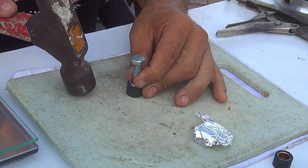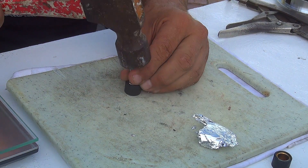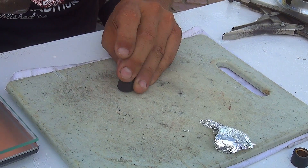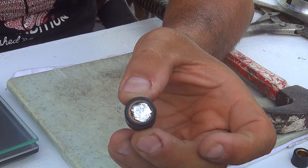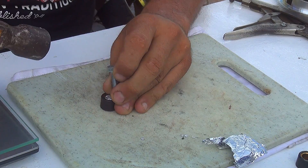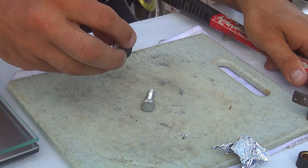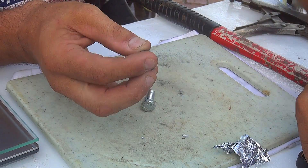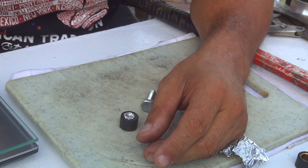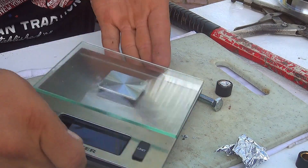Work on a cutting board so you can do the job properly without damaging anything. Press the foil in carefully — make sure the bottom is nice and flat and the weight is centered. This is an easy way to add more weight to your roller. This modified roller went from 10 grams to 12 grams, which will make a big change to your scooter's performance.